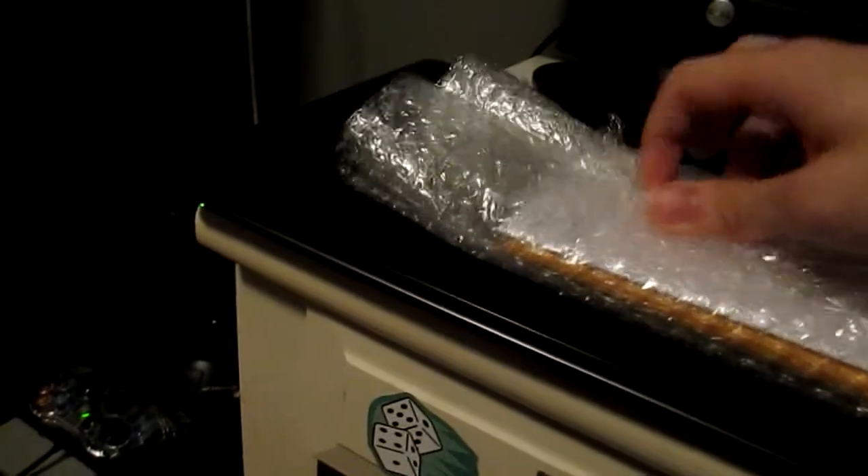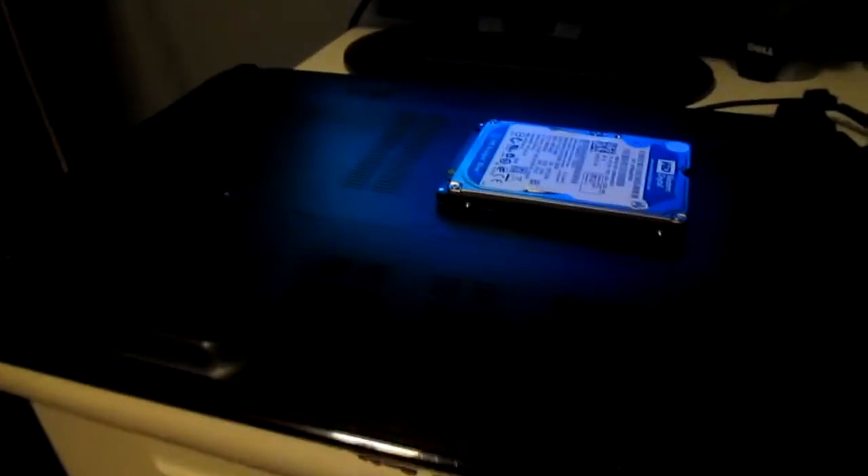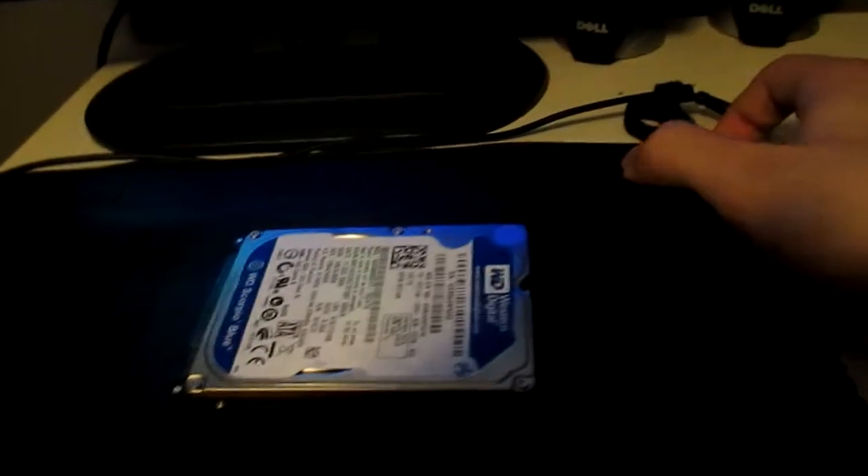First things first, we have to get the hard drive out of all of the packaging. Alrighty, so we've gotten the hard drive out — here it is: the Western Digital 500 gig Scorpio Blue Series 5400 RPM model. Wish it was a 7200, but anyway. What you want to do is remove the battery. On the Asus K55N you have a tab here and a tab here. You pull this one back and then pull this one back — it's spring loaded so you have to use two hands. Pull the tab back and the battery slides out. This is the standard 6-cell lithium ion that comes with the K55N.